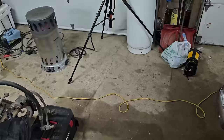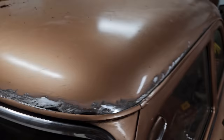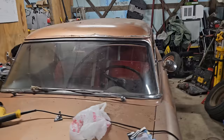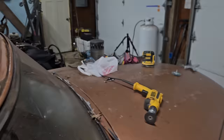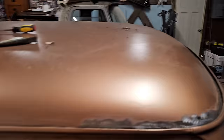I've got the heater cooking so we can get all of the moisture out of this car, because this metal is gonna have some moisture in it since it's been below freezing and everything for a while. So we're gonna hold the garage at a steady 50, 60 degrees for a couple hours, get the wetness out of it, and then we will be ready to clear coat the old grill. Only thing I'm worried about is that heater over there takes a lot of juice. So we'll pray that that tank does not run out in the time frame that we needed to stay warm.